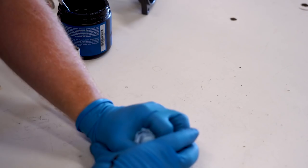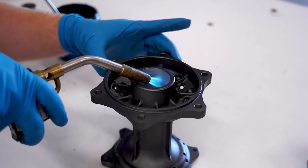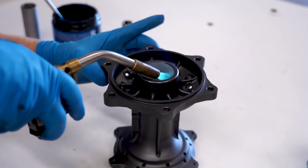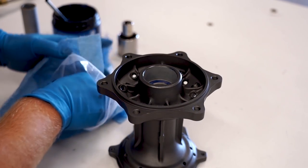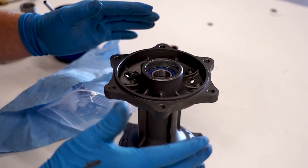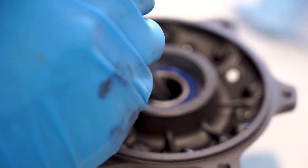Make sure you give a lot of heat to this thing. Make sure you don't have the torch tip in the hole before you start — just give it lots of heat. That'll help things slide in a little easier, and even with it Cerakoted, it isn't gonna harm that coating at all as long as you're not heating directly on the Cerakote. You can see it's kind of hit and miss and you've got to work really quickly. I'll tap in the bearings until the collar in the middle is just barely able to move — it has a little bit of play but isn't floppy in there.